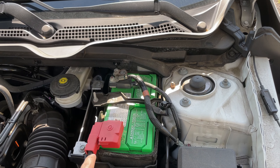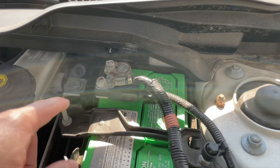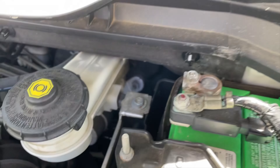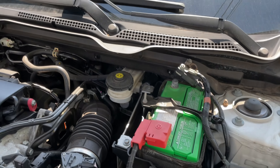The first thing you want to do is go ahead and disconnect the battery. You can do that by turning off the negative terminal, which is the black cable — all you have to do is unscrew that bolt right there and then just pull it off. This is so that we don't short anything out in the car or blow a fuse.